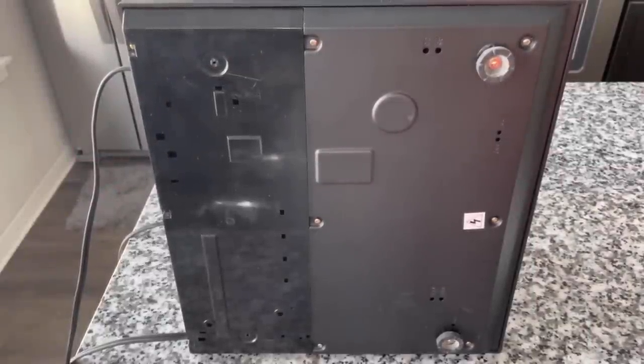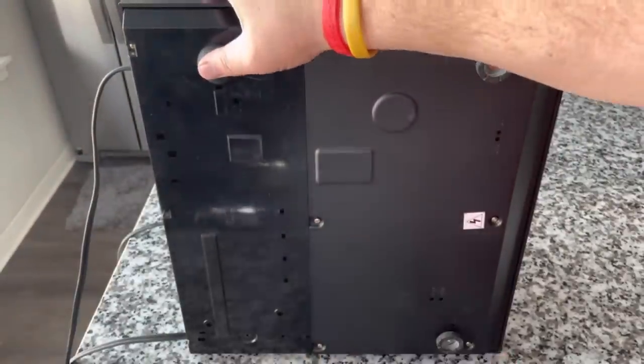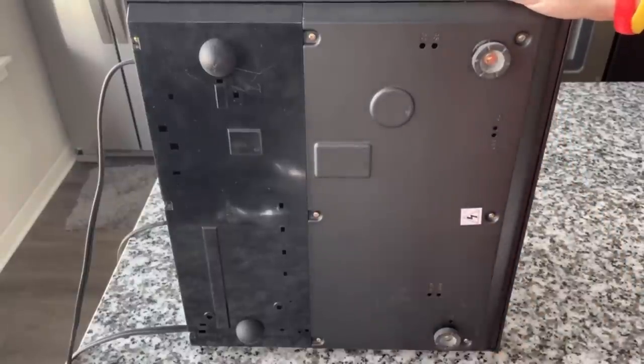Looking on the bottom, we've got a couple of adjustments — motor speed adjustments and what's probably a reject point adjustment regarding when to play, when not to play, where it drops on a seven-inch record, where it drops on a 12-inch record. We are missing two feet — the front two are there but two are missing in the back. I'm going to use some Hudson Hi-Fi replacement rubberized feet. They're just a hair too tall, but better than nothing. Obviously any turntable, you want it to be as level as possible.